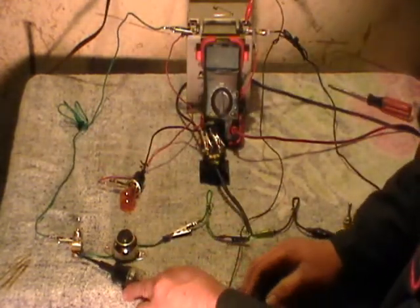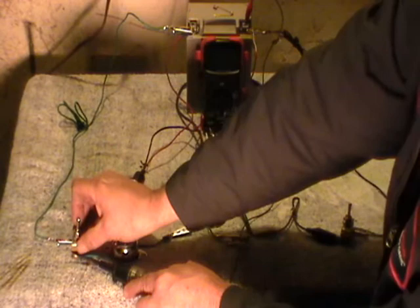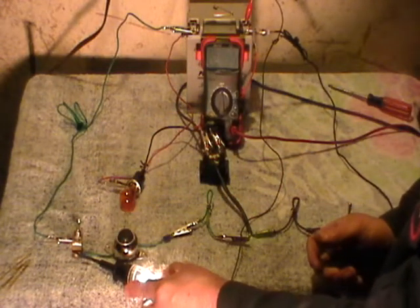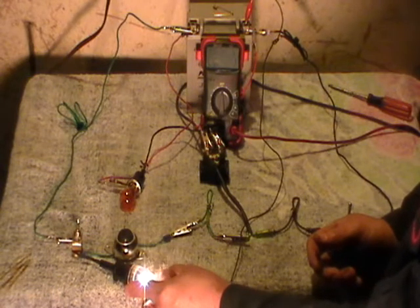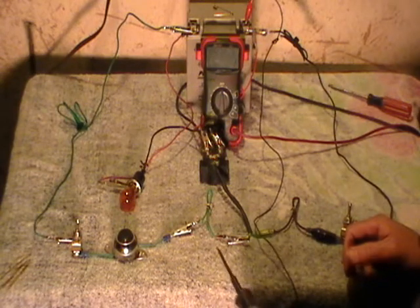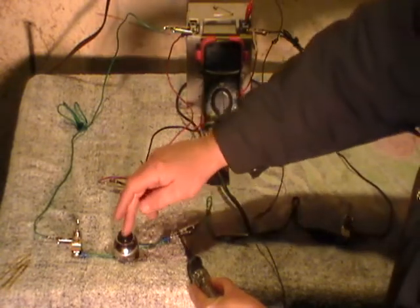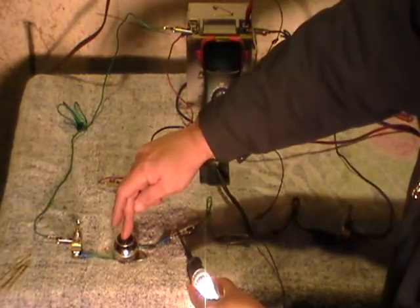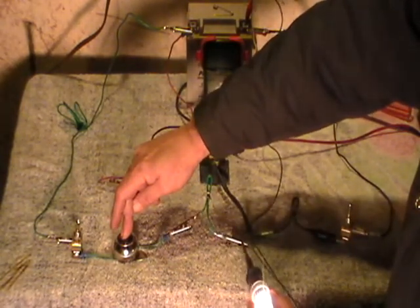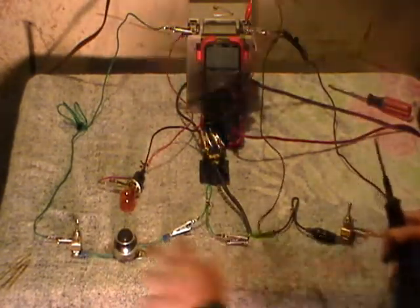On the other side of the clutch switch, I have no continuity — because the switch is off. I have to pull on the clutch to close the circuit. As soon as I pull on the clutch and operate the switch, I have good continuity and can continue testing. I go to the push button switches on the right-hand side of the cluster and I have no continuity again — because the circuit is open. To close it, we push the button, and we have good continuity. We can test all the way up to the starter solenoid — this is our ground side, going through two switches to supply ground to the starter solenoid.